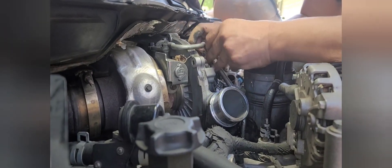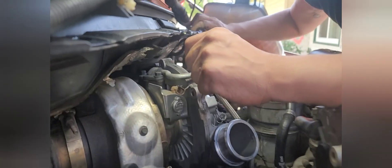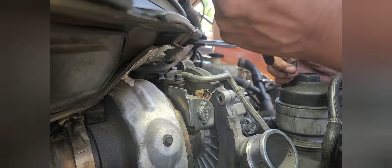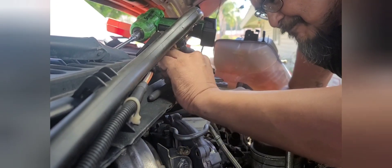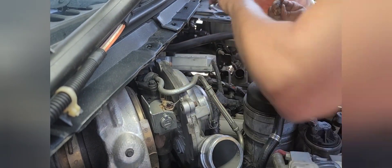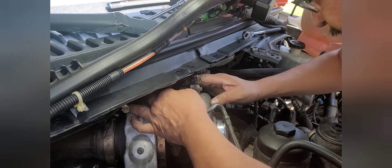As long as you know when you take it apart what you've got to do to put it back together — if I had seen that coming in, I have old 7.3 injector harnesses with that same exact clip and I would have brought one to replace it. Next I'm going to take off the feed line to the turbo using a ratcheting 10mm. There are two bolts — once you crack them loose you can run them off with your fingers, pretty simple.